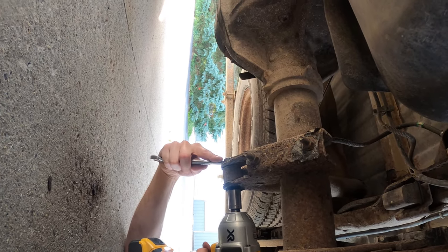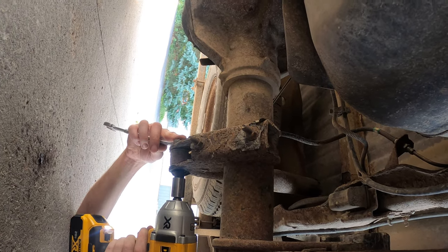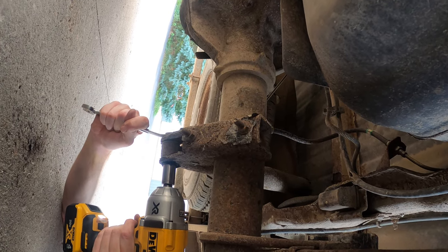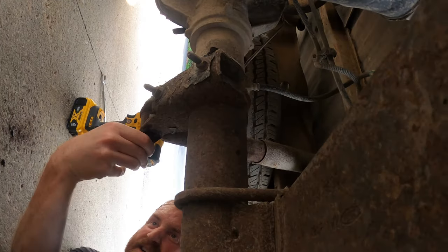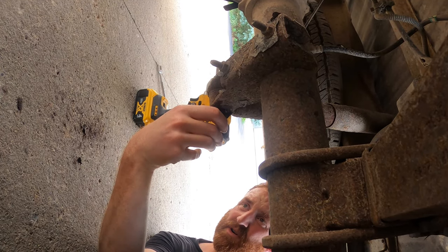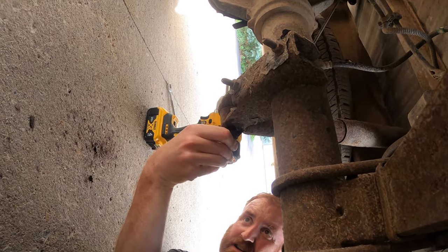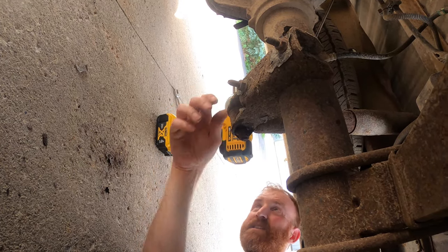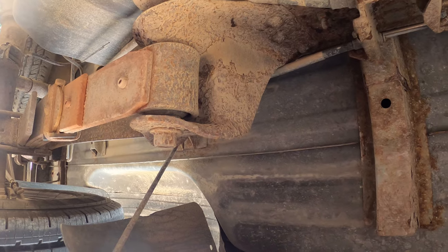Stop moving. You got new bushings, right? You can put some heat into it. It looks like somebody tried to jack it up and they crushed it, and the edge of the bolt is kind of rounded off over the thread right there. There's something weird going on there. But either way, maybe I'll try it, because this doesn't have a whole lot of leverage. I'll try to break it with a breaker bar first and see if it's going to work. It might strip the bolt. Might be.